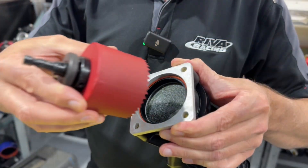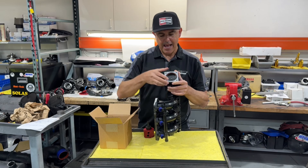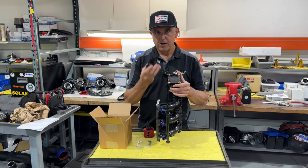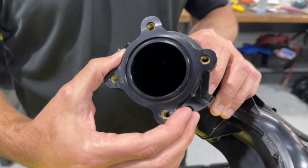It's perfectly sized to drill out the plastic body of the intake manifold so you can release the honeycomb fixture. After the insert is removed, you insert this nice billet aluminum smoothbore insert, which is sealed very nicely with multiple o-rings.